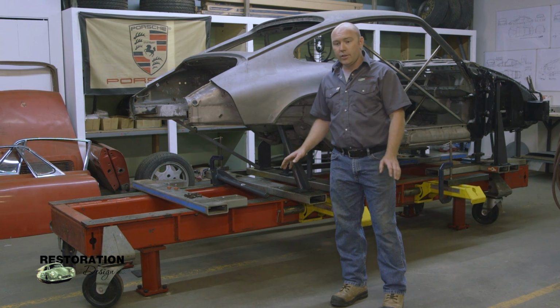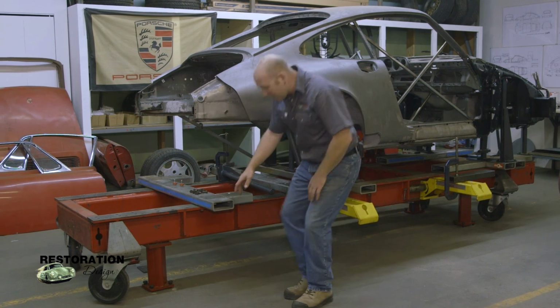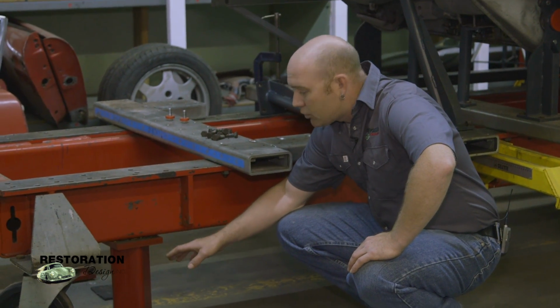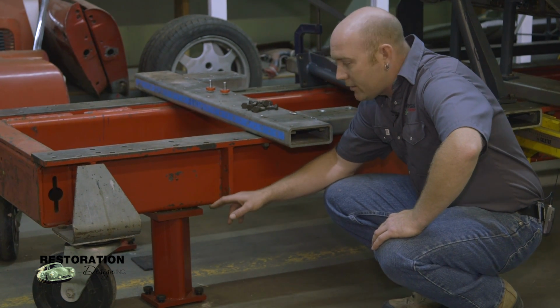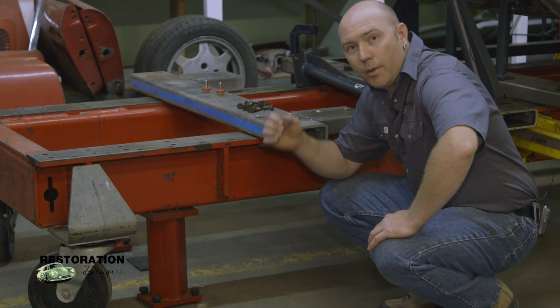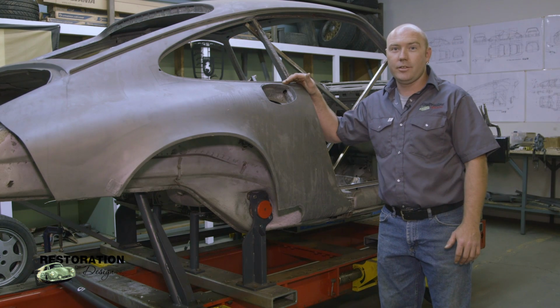We moved on to putting the car in place over here, and then I made some custom legs down here that have bolts on the bottom of it so that I could adjust the car and make the car bench completely perfectly level on the floor. What this does is this allows me to use a laser level to help me with my zero plane on the car.